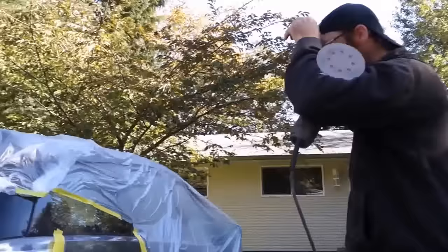So the second coat of filler will basically take care of these. Yeah, it'll take care of any of the minor imperfections there, and then I'll block that out so I know it's level. If you don't block it out, then you have a tendency to leave low spots or create a low spot. It seems smooth, but it'll create warbles if you don't block it.